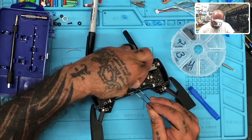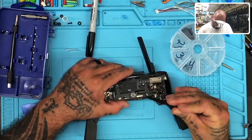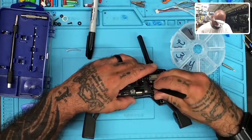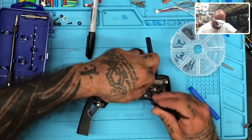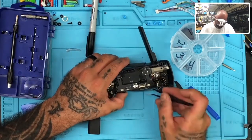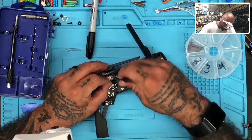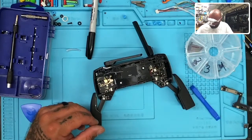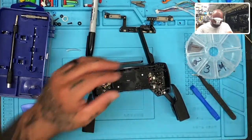This is taped, so we're going to nicely lift the tape with the tweezers, slide it over and lift it up. We should have a pretty good range of motion now. When you see tape, you always have to look for a ribbon — there it is right there. Be careful of this ribbon. Put your tape aside and save it — it's not ruined when you peel it off, it's actually pretty good tape. Flip that up for your ribbon, pop the ribbon out.